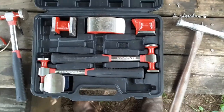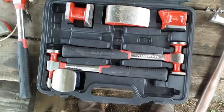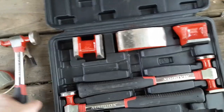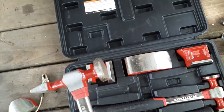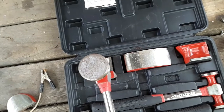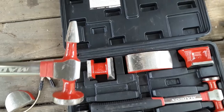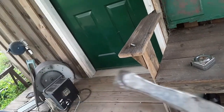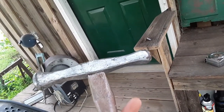I'm nobody — didn't go to school for body work, didn't do anything. But I've got this kit right here and I've had it for a while. What I'm getting at is I bought this flat-face hammer kit and these are okay for some things. See how that face is flat — that works out good sometimes, but if you don't hit it straight you'll make marks in your metal. What I found is a curved hammer — see how that's round — these work really, really good for knocking dents out.